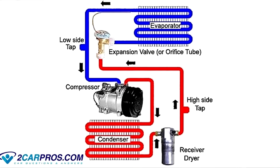Before we go any further, we should definitely go over how exactly an AC system works. I have on screen a nice diagram — just follow along with me. We'll start on the low side before the compressor. Refrigerant is added in there on the low side, and it's fed into your AC compressor where it is compressed into a high pressure gas. It is then fed into an AC condenser where it is cooled and condensed into a high pressure liquid. It then goes through a dryer — sometimes the dryer is elsewhere, but usually it's after the condenser because they want to pull as much moisture as possible out of it, since moisture is going to be the enemy of the inside of your AC system, corroding and ruining everything.